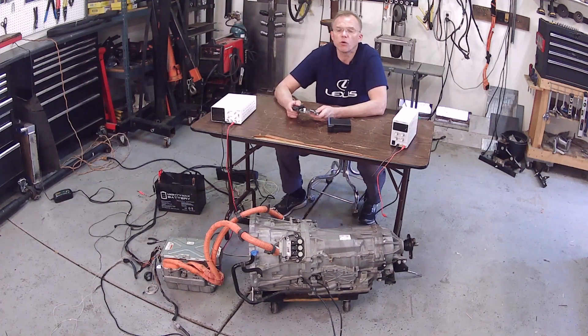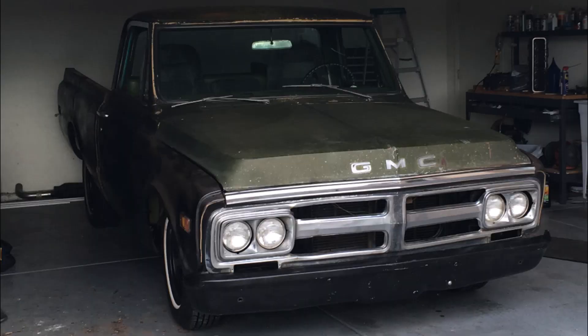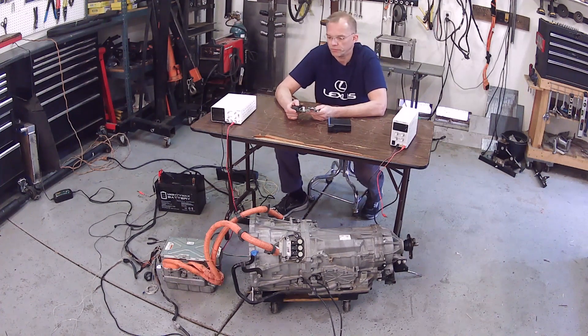Anyway, we could just go by RPM, but I've used a formula to set up what I guesstimate are the miles per hour. I factor in the gear ratio of the 1971 GMC that I'm about to convert to electric, factor in the tire size and circumference, and came up with a formula that I think is pretty accurate.